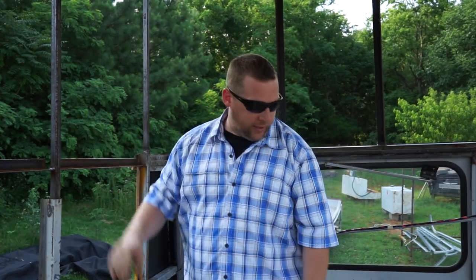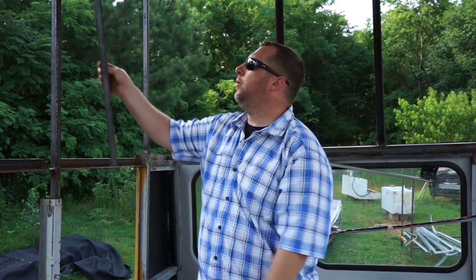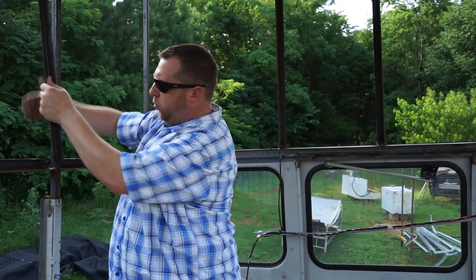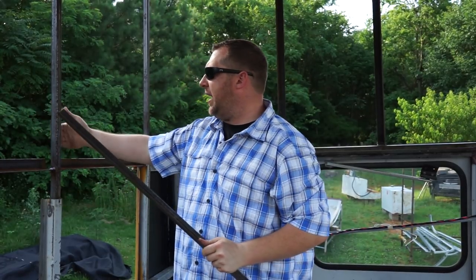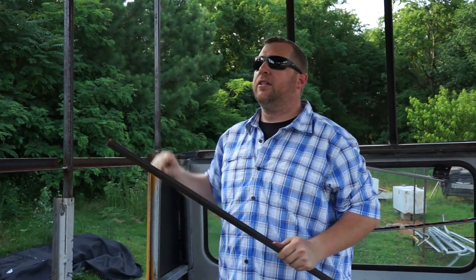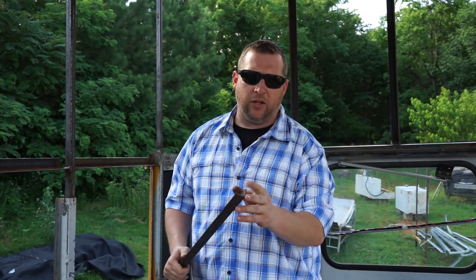I'm going to be putting a layer of skin back on — some sheet metal on the sides — and then closing it in the back as well. I'm going to be using rivets for that, so I've got to have something to attach those rivets to. What I did was I took 1 inch by 1 inch by 1/8 inch thick angle steel and attached that to the side of the square tubing, lined it up flush with the outside of my channel so that whenever the skin comes through, it'll all line up with the outside of the bus.